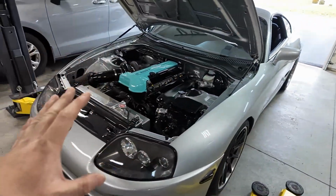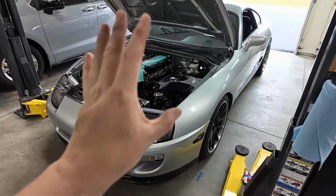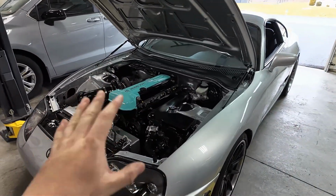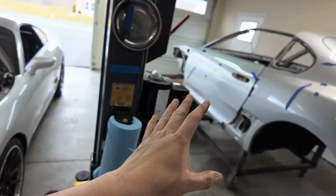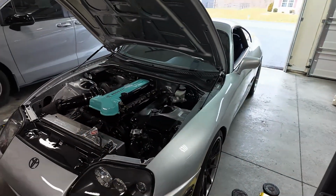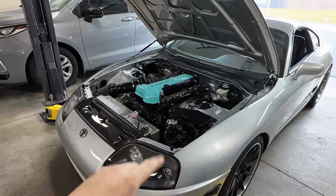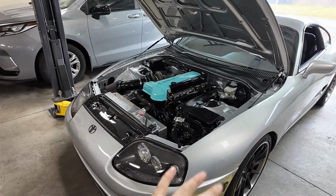One thing that has been very quirky with this car versus this, they both have the same ECU. I've got pretty much the same setup when it comes to the idle control, but this car, no matter what, is always somewhat off. And it has to do with the load of the transmission, where this is a manual, so it doesn't matter. Idle's idle, things of that nature. It doesn't change. I can get this thing dialed in, have it perfect on warm up, everything. And you have to have 2 different idle tables, whether you're in park or neutral, and then in reverse or drive. There's more load in reverse and drive versus park or neutral. So I have that set up.